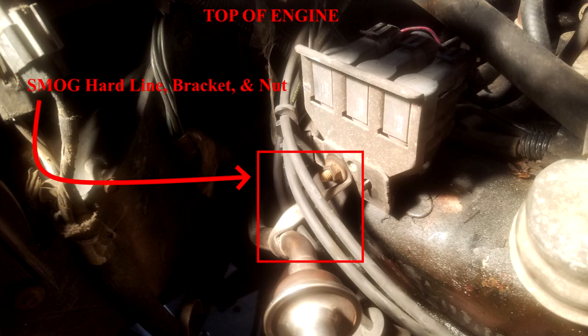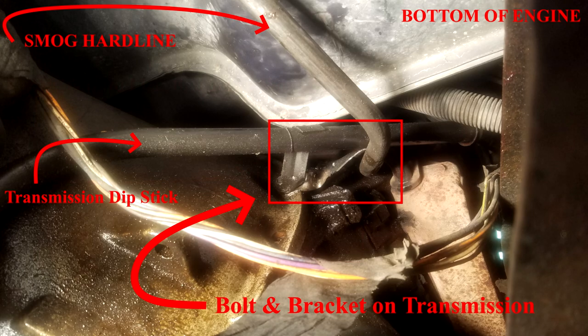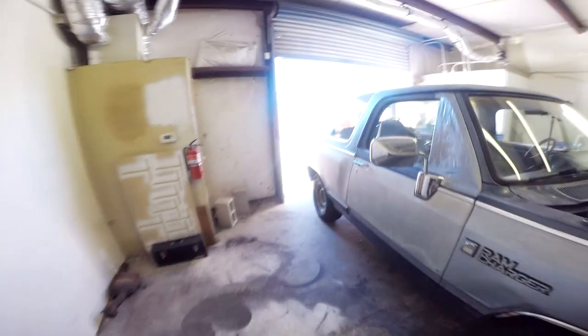And over time, the heat of the exhaust will actually start to kind of semi-weld all that together, so it's not going to go anywhere if you tighten the bolts down enough. And then how I hung it is I used those universal hangers with baling wire, and that's how I finished adjusting everything to get it to hang upright and get it tight and stuff like that. But as you can see here in the footage that you're seeing now, it looks hell of a lot better.